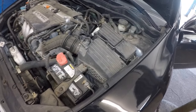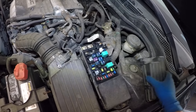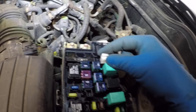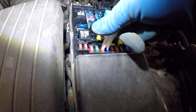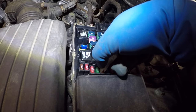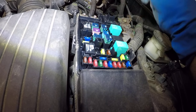We're right at the fuse box here by the air intake housing. Push these clips in — two on each side — and yank the cover up. Inside you'll find a small fuse puller tool. Squeeze it, place it on top of the fuse, grip it, and yank it out. That's how you pull a fuse. To reinstall, the fuse can go in either direction — just push it back in.